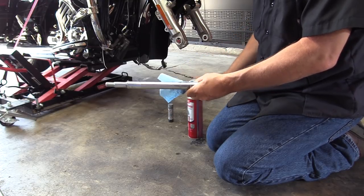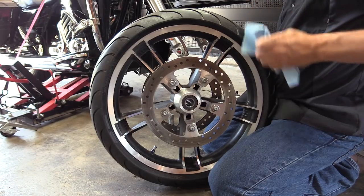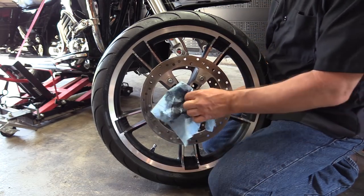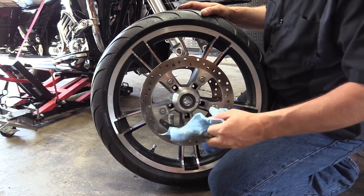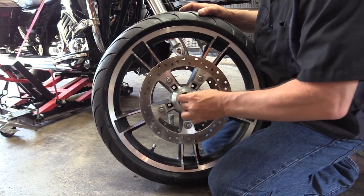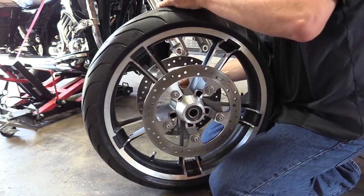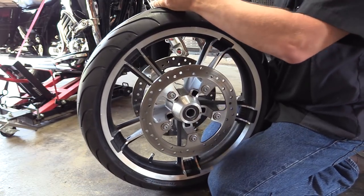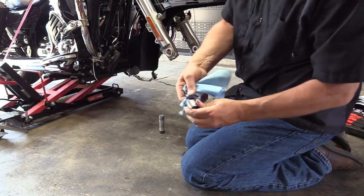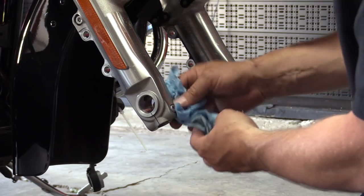Just a light solvent to get any hard residual that didn't come off easily. We're also going to clean out the bearing bores and the bore inside of the wheel — just a little bit of brake cleaner in there, pushing it through to get all the way through. Clean that up real good before we put the anti-seize lubricant in. Go ahead and clean out the inside of your spacer as well, and also clean your fork where the axle goes through on both sides.